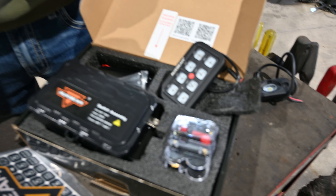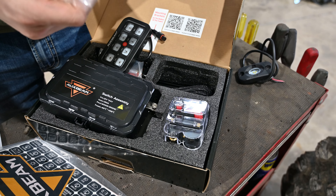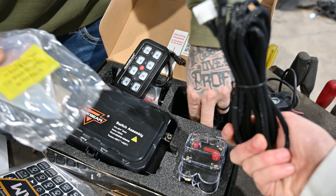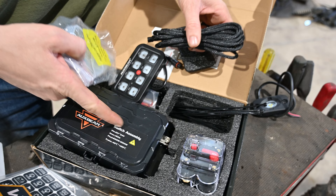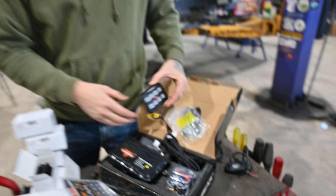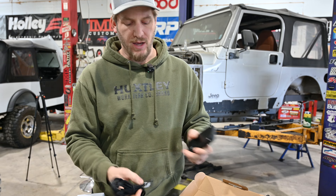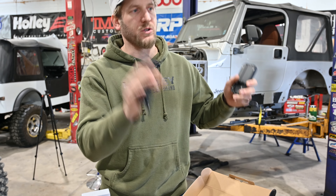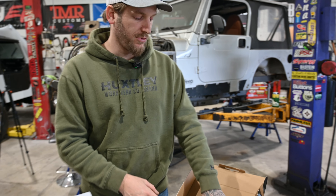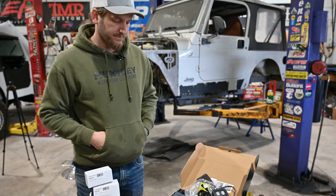So that's what's in all the boxes — mounting brackets, wiring harness to hook it all up, harness for the switch panel, and a bunch of zip ties. They also include a little water guard connector cover so when you pressure wash it, it's protected. The cool thing is a lot of people used to just put a bunch of individual switches on their dash — all kinds of wires inside. Now you just have this one wire that's hooked together, only four wires, all solid state. Keeps everything in the dash really simple. It's well packaged and well put together — a lot of people run the eight gang style and it's a good unit.